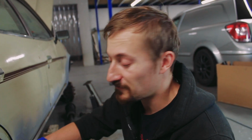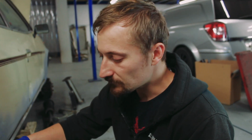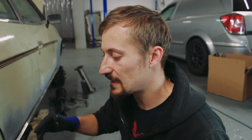Because I also don't want to run a 195/65 tyre. I would like to keep a higher profile tyre for the look, but they just don't do really good performance tyres in a 65 profile, and this is a problem I come up against a lot, really. So you are looking at realistically a 50 profile, and I know my ideal rolling wheel size is 600mm, and so a 15-inch 50 profile on a minimal amount of stretch, so let's say a 235 on a 9 or 10J wheel, gives me 600mm. So that's kind of what I'm aiming at, really.